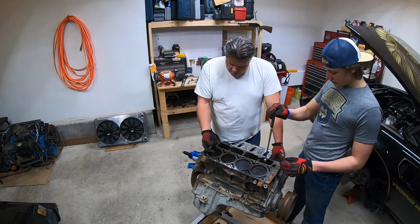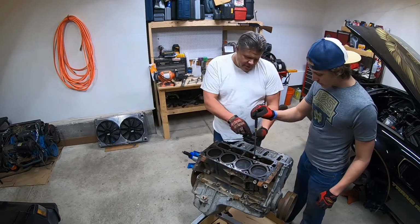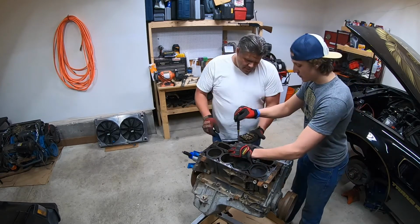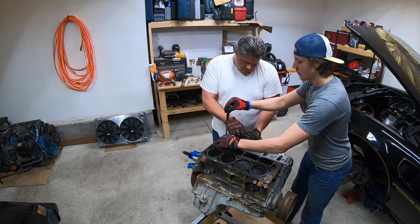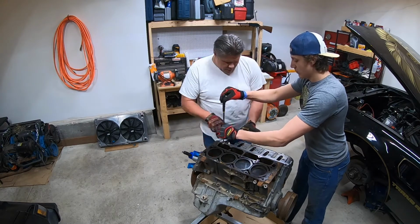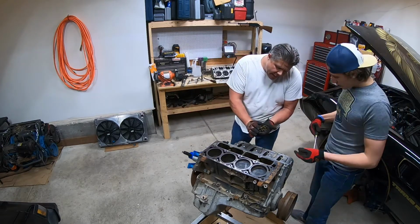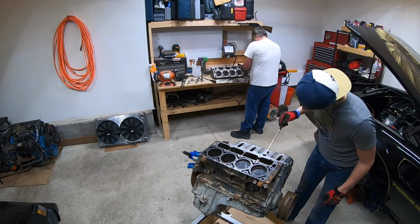Now, with your regular flat tappet lifters, these guys would seat to the cam, but these are roller lifters, a little different story. Plus, what I've seen some people do with reusing stuff, I'm not too concerned. The only issue was that one right there. Yeah, it was the far one. There's like rust around it too.